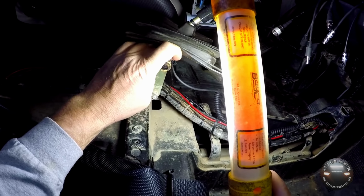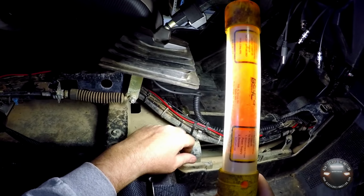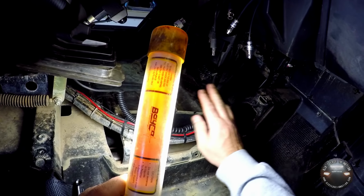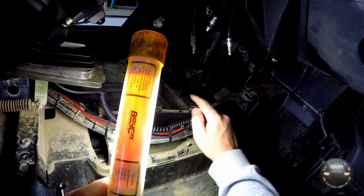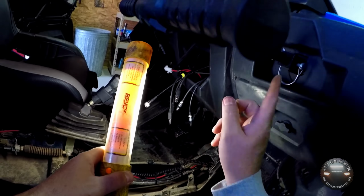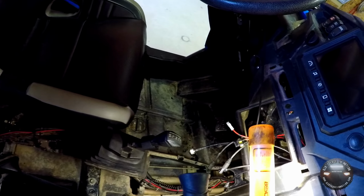This is where it's going to be tied on, and all this does is rotate, so there's really not going to be any motion here much at all. And I just ran this wire along with all the others. These are my winch cables, the power wire that feeds the bus under the hood, and I just ran this push to talk button right out with the winch cables and back in through the grommet and the firewall. It came right out here in the dash.